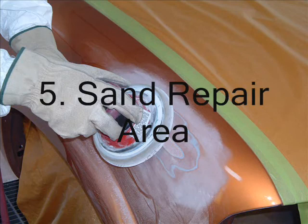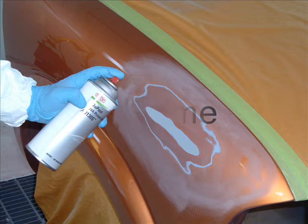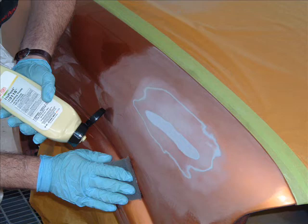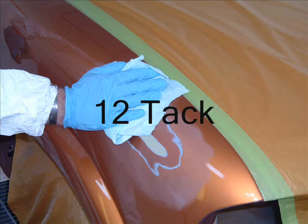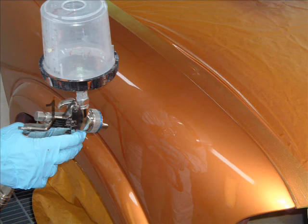Step 7 — prime with UVA Primer Surfacer A3130S. Step 8 — sand with 400-grit paper on a DA sander. Step 9 — scuff the panel with 2311S sanding paste, then remove sanding sludge and cleaning paste residue with PS3909S. Step 10 — mask the area for top coat; for HC7600, mask to 36 inches. Step 11 — wipe the surface for final cleaning. Step 12 — tack with SPS final tack cloth. Step 13 — apply the base coat. Step 14 — apply two coats of ChromaClear HC7600 low-overspray clear coat. You've restored the vehicle to its pre-accident condition using the DuPont Chroma System Non-Stop Process — from start to refinish, prep time in 30 minutes.